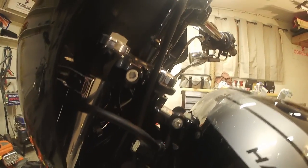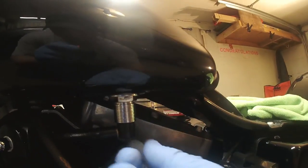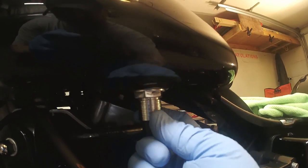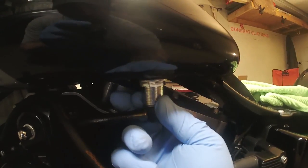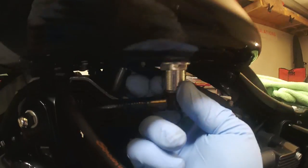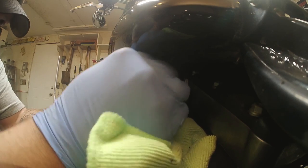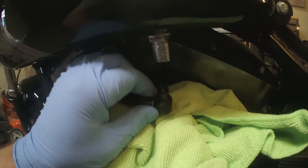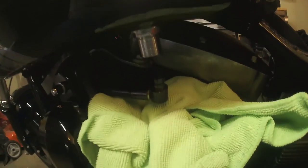The next step is to disconnect the main supply hose or tube — this is a quick connect fitting. This silver part slides up while this slides down. If you're not experienced with how these work, you usually want to push up on the hose and then work it a little bit. Now you'll pop that line down — I'm going to use two hands for that just so that I don't break a nipple off. There will be fuel in the line, but at that quick connect fitting there won't be any fuel, so just a little bit will drip out. I actually barely even got a drop. You've got to work it a little bit, but it's not too bad.